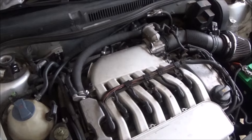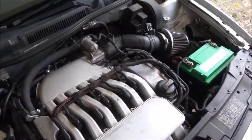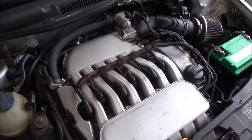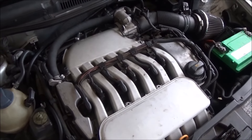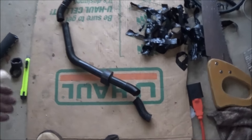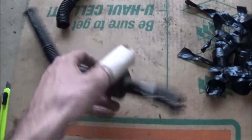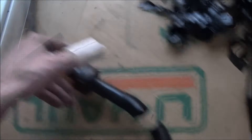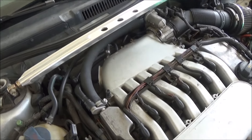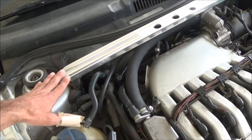When I just started the car I had to pump the gas a couple times, which is what I thought — I didn't think fixing the vacuum lines was going to change that. Pretty sure I need a fuel filter, so as soon as that gets here in the mail we'll change it. I haven't got the lean on idle code again though. My PCV breather hose was broken into four pieces — I took all the electrical tape off just to show you guys. That was the only thing holding it together. Electrical tape will hold it together for a little while, but eventually you should do this. Now that I have all my vacuum lines and breather hose fixed, we can put our strut tower brace back in.